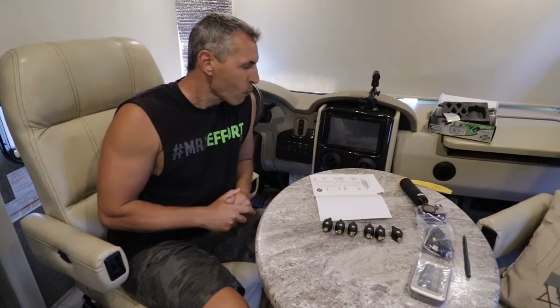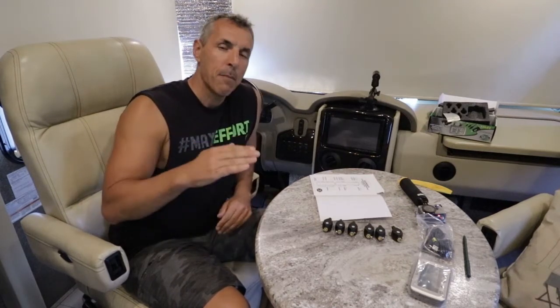The source that I chose is I actually called Thor Direct, the manufacturer, to their customer service, and I asked them, what is the recommended tire pressure for my particular RV? They're going to ask you what year it is, and they're going to tell you what your cargo carrying capacity is and all those things. And my unit's recommended air pressure is 100 PSI. However, if my cargo carrying capacity is above 50%, then it is recommended by the manufacturer that my PSI is dropped down to 85%.